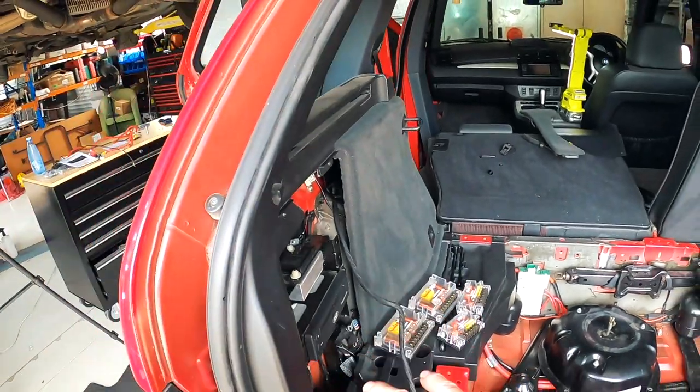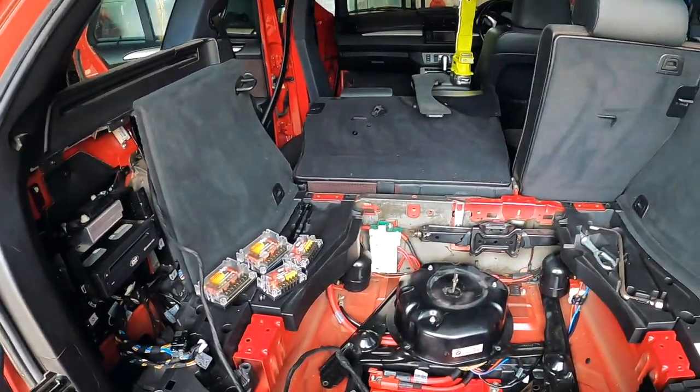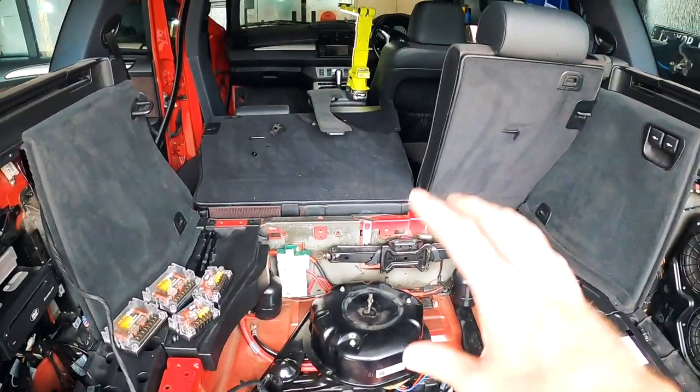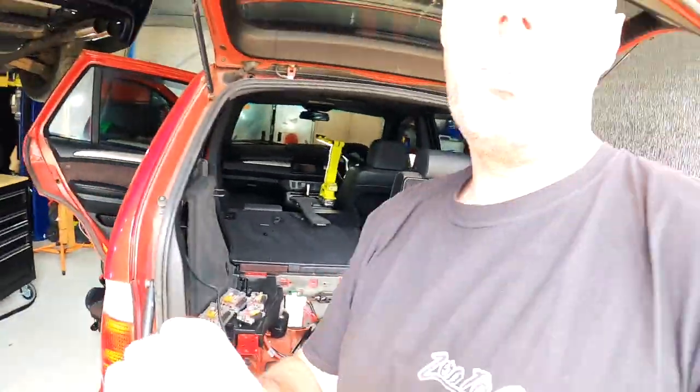I will cable tie it up. I want to run it in place and plug everything in, make sure it all sounds alright, start the car, make sure there's no interference, and then we know it's going to be fine. Quite often when you're putting aftermarket stereos in, depending on where you position the cables — BMW's aren't too bad — but where you position the cables can actually cause interference into the RCA, so I just want to check that the path I'm going to run them is fine before we lock it all into place.